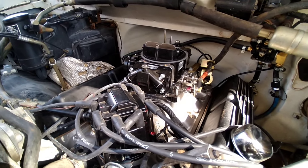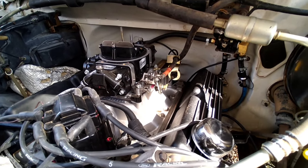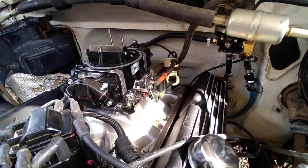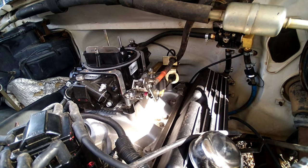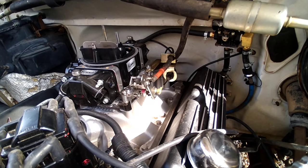On this throttle bracket, it was actually for a Chevrolet with the 700R4. The AOD cable fits right in there, but I did have to take a die grinder and massage the throttle cable a little bit because Chevrolet is square and the Ford is round.